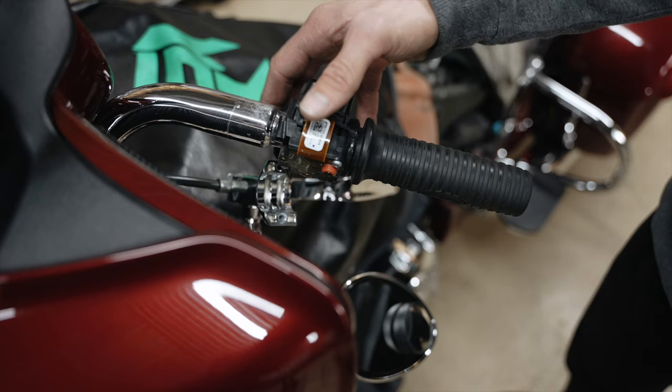Now we're going to disconnect the throttle by wire sensor. There's a tiny plug inside the bar — we're going to back-feed the electrical harness through the end of the bar. The big plug on the end of the electrical harness can't get through the frame of the fairing, so we go all the way out the headlight hole with the whole harness. Keep feeding until you see the gray plug stick out. Get a small flat head, depress the tab, and it'll come disconnected. Then pull the whole electrical harness out through the headlight hole, feeding a little from each side until it pulls right through.